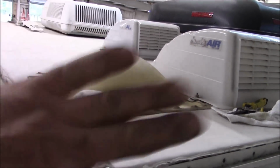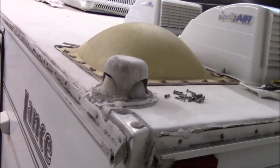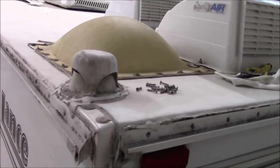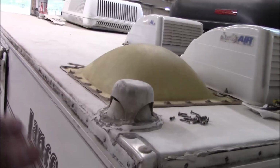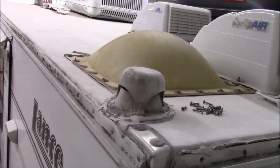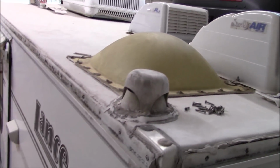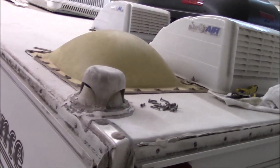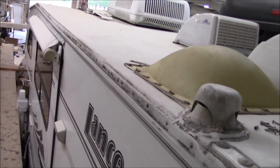So obviously the goal is to get everything off the roof. Once we get it all down, check the roof deck, make sure the roof deck is nice and solid and sound, and if it needs to be redecked, we'll end up redecking the roof. Then we'll get the roofing on there, get the material up, glue it down, get all our curbs made. And that's typically what they do, is just strip it so we can find out exactly what we got. Do we have all the material here? If not, get it ordered real quick or go buy it, whichever we have to do.